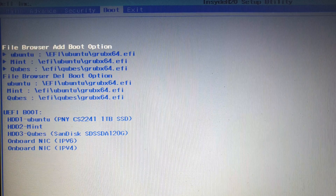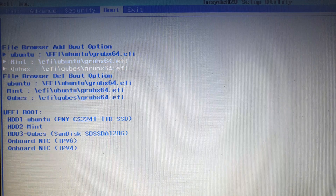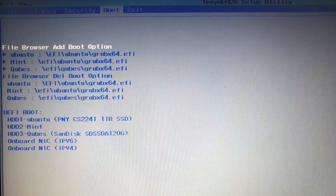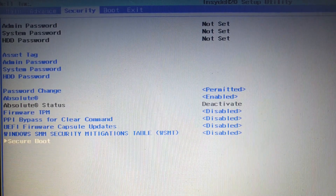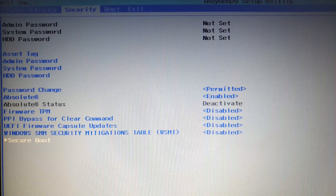What this system does give us is the ability to create a custom boot option, but it's better to just let the system show you the options and use the one-time boot menu. For our situation, just boot off the USB drive from the one-time boot menu once secure boot is disabled. We're going to have a look at another one — a desktop computer — that allows you to say 'if there's a USB drive, boot from that first.' Here we are on the MSI B350 board.